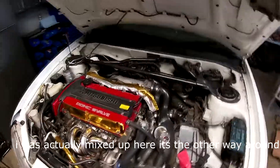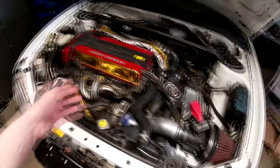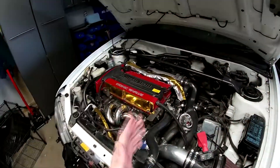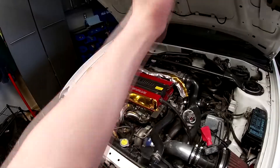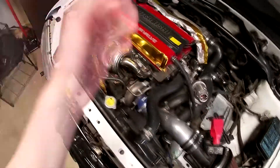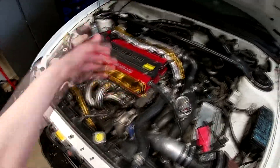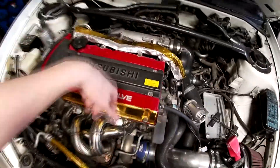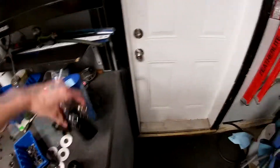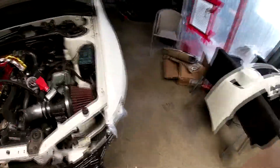For those who don't know, on most cars but especially turbo engines, there's a lot of blow-by, which is air that gets seeped through the pistons during the compression stroke. That ventilates your crankcase, which is what your PCV is for. But there's always going to be some left because it's going into your intake to be burned — and a catch can helps reduce that by trapping the mixture of air, oil, and other stuff in the bottom of the can.